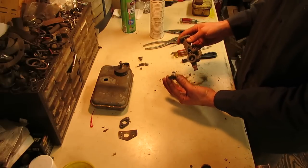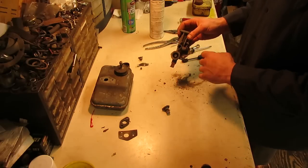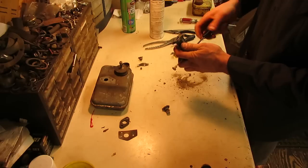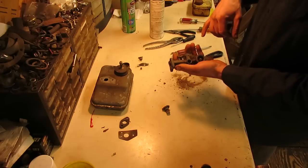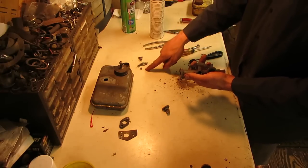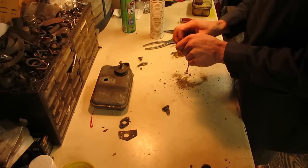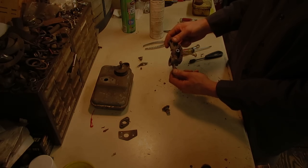That way you can clean out your carburetor, your venturi, you know, and all that junk, whatever you want to call it. So because the mud wasps are in there, I had to pull that out. That way I can get everything cleaned out nice. I might hit this with the glass bead blaster to get rid of those wasps' nests that are way up inside of here. And it would also give me a chance to clean out the seat for the idle needle too, the little brass seat, and get that cleaned up. But aside from that, folks, it's really not that bad whatsoever. So it's going to be an easy cleanup job. So I'll get this thing ready to go back together and then check in with you guys before I reassemble.